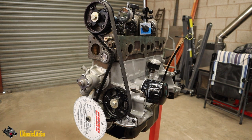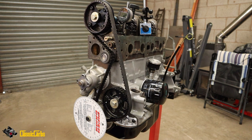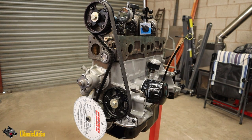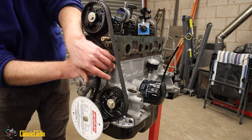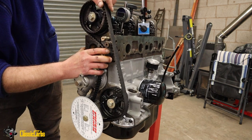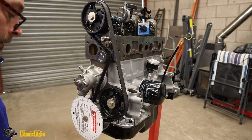So we're behind. Well, I don't know what is behind. The cam is behind. The cam's behind. So the cam needs to come forward a bit. So to do that, either slacken these screws or take the belt off, rotate the cam forward one notch. Let's do that then. And then, okay, so that's one notch, I think. Okay, I'm gonna go for a revolution just to make sure we're not touching anything. Gently.